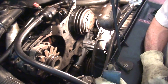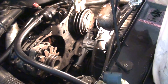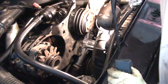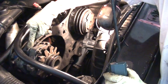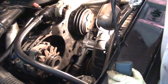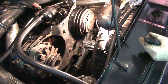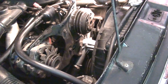Three of those screws go through a large metal plate and into the water pump and then into the vehicle — those are located on the bottom of the plate. There are also screws to remove the plate itself: one on top of the air compressor, two on the bottom of the air compressor. You'll also need to take the alternator off — there's a tensioning rod and a screw on the bottom of the alternator. There's also a bracket near the dipstick for your oil, with a tube that the screw passes through — make sure you don't lose that tube. Additionally, there are screws on the other side of the vehicle connecting the water pump to the smog pump bracket that also need to be removed.